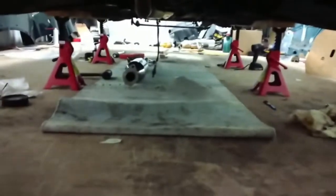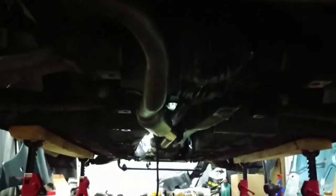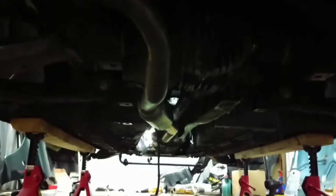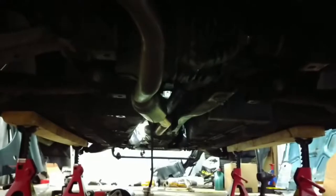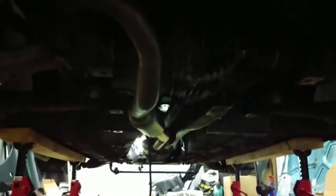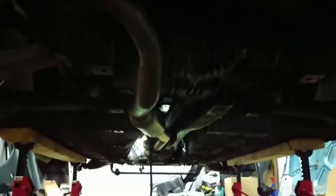We'll have to go under the car and have a look — there is a mess under there. I've replaced the differential mounts and basically the entire exhaust from all the way forward to back. I'm currently in the middle of that process. I've also changed the clutch for a sport clutch and a lightened flywheel, so I've had the entire drivetrain out and I just put it back in today. That was a lot of work, to say the least.